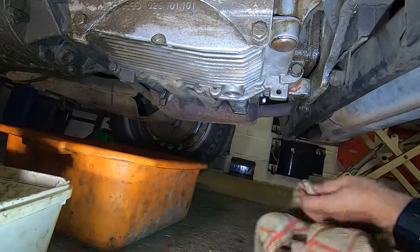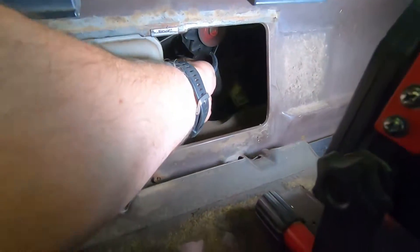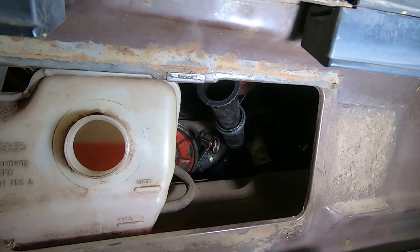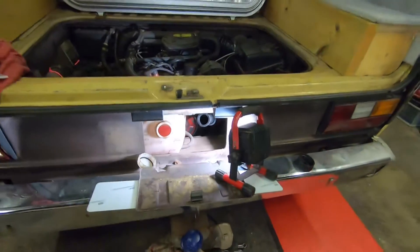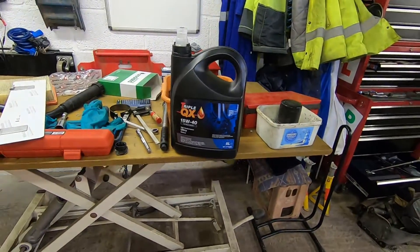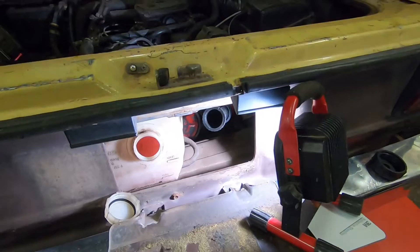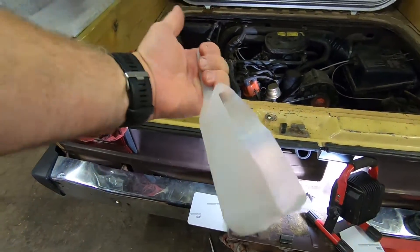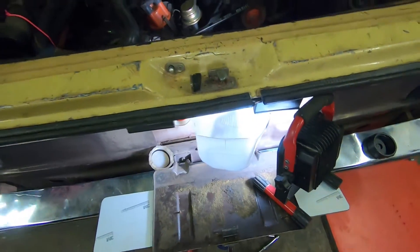Let's put some oil in it now. I put the second-hand oil filler in but it was impossible to pour oil through, so I've gone back to the original. We've got five litres there and it's four and a half litres if you do a filter change. Those of you who've done this before know it's a pain to get anything in there, so I've got what looks quite rude but is basically a cut-up milk bottle — it's slow but it's non-spill. You just bung it in there and it slowly goes in. Let's fill it up with oil.